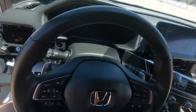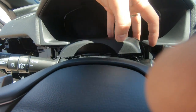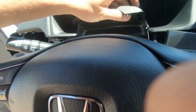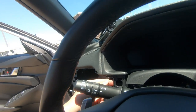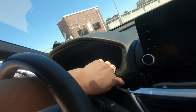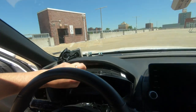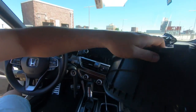At this point it's gonna be two bolts — one and two. Remove those two Phillips head bolts, and then pop this cover up. With your flathead screwdriver, just pop it up on the side. As you can see, we have room now. We can remove the cluster cover. There is one clip over here — pull it like that — and there is another clip on the bottom. Pull it the same way, and now you can remove the cover out.